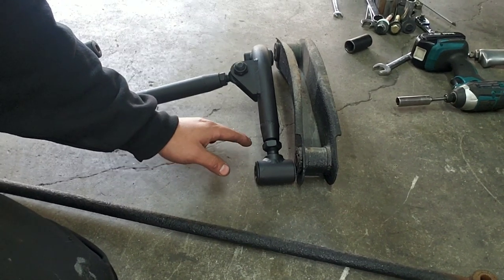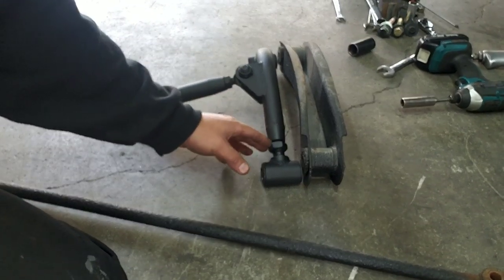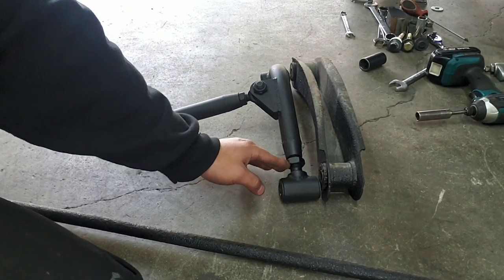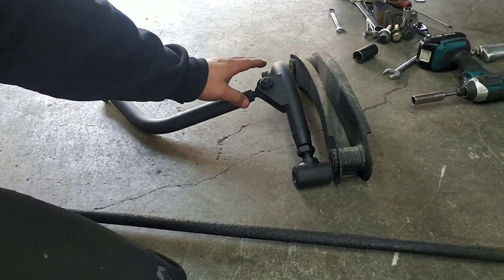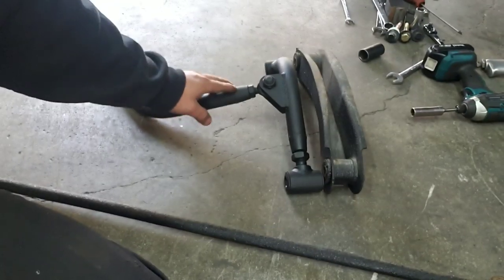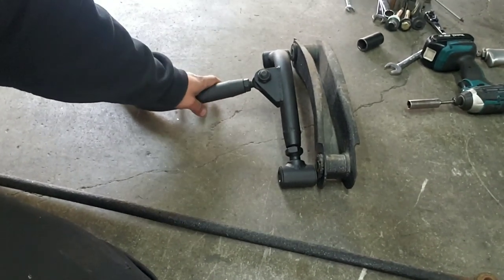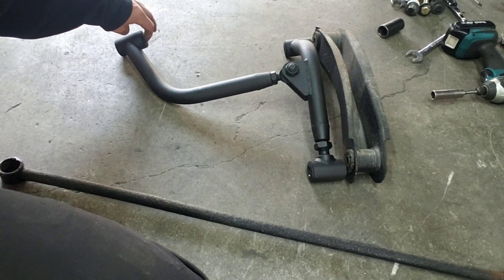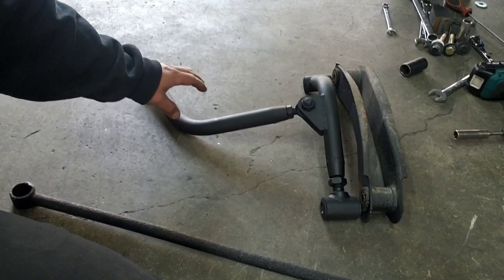This pivot doesn't affect the driving — it actually makes the driving experience better. We also have a full adjustment so you can correct your pinion. When you eliminate the shims — some cars have them, some don't — that's a GM factory variation, similar to door shims, body shims, and fender shims. You'll want to get your pinion within three degrees. These come raw steel; we painted these black for this install. They are fully TIG-welded, and ours feature polyurethane bushings with machined-out center sleeves for a seamless fit.